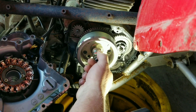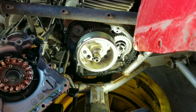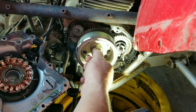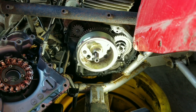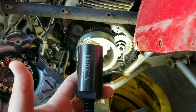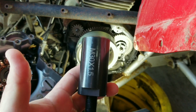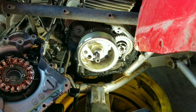The next thing we need to do is remove this nut and the washer behind it - it's 19 millimeter. I used a quarter-inch impact to remove it; it came off perfectly easily. It's hard to do without an impact because you're going to have to hold the flywheel still while you turn the nut, but it came right off even with my small quarter-inch impact. Now the puller listed on eBay for the Polaris Phoenix flywheel will look something like this - they're fairly expensive. But this one for about 20 bucks does in fact fit.